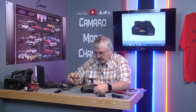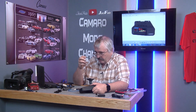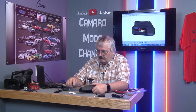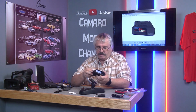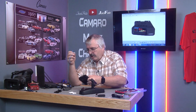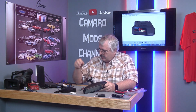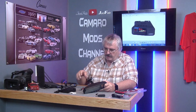And these wires here, with your instructions, it'll tell you that the white wire is ground, the blue solid color is the power wire. And that's kind of like a phone connector. It clips in, RJ11, I believe is what they're called. Connects into the side of the radar detector. So we'll get the camera up here closer so I can show you how to strip that back, and then we're gonna solder it together and put some more heat shrink wrap on it.